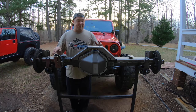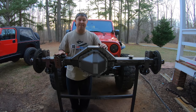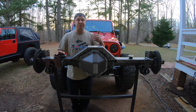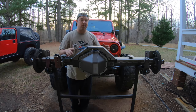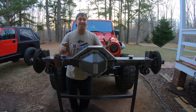In this video, we're going to do step by step on how to get this installed and welded just like this with a perfect outcome. Hopefully you stick around whether you're doing this swap on a JK, a TJ, an XJ, or you just want to learn more about welding a truss onto any axle — whether it's the stock Dana 44 or Dana 30 up front. A lot of the same principles apply.